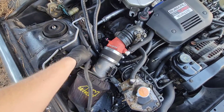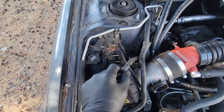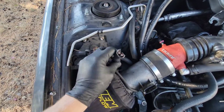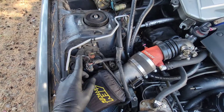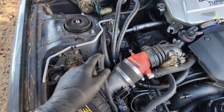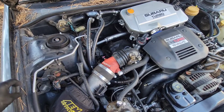The main things we need to wire: we unbolted this whole assembly from a turbo car. It has the MAP sensor, the check valve for the MAP sensor, and the factory boost controller. I'm probably going to pull this back out because there's a connector for the automatic shift solenoid, which we obviously don't need since it's a five-speed. There should be about seven different wires we need to make a harness for, run into the cabin — mostly five-volt reference wires and some grounds — and then pin them into the ECU in the correct locations and move the cam and crank sensor wires around.